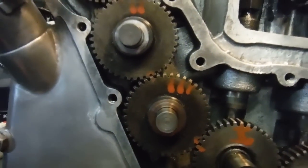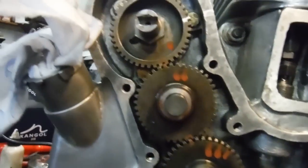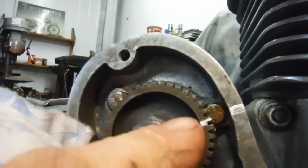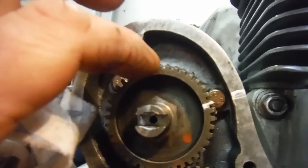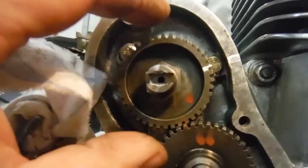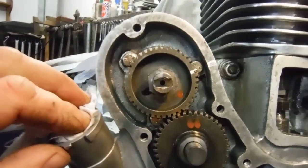While you're doing this, it's worth keeping an eye on the ignition timing — it didn't move there for me, but as a little bit of a backup, you might be able to see I've marked the position of this one at top dead center, so that if I did lose the timing it'd be easy for me to find it again.